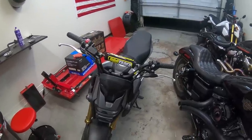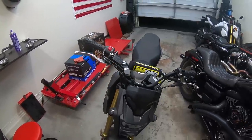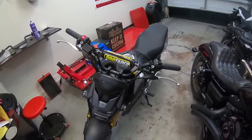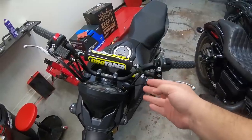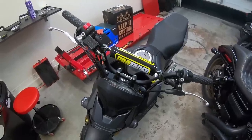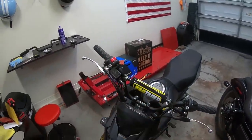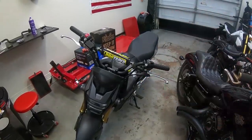Just went for a quick run — everything works great. The throttle feels so much better with the Chimera quick action throttle tube. You have to turn it a lot less for the throttle to be responsive, which is really awesome. That's how you install new bars on a Honda Grom — pretty sure it's the same for Gen 1 and Gen 2; the bike I'm working on is a 2018, which is Gen 2. With the bars, you do have to get some slack out of the cables — find it and lengthen them just a little bit. Overall it works and feels really nice.